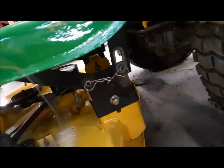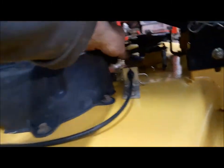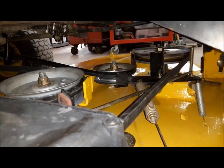Last thing we have to do is engage the PTO cable. First, this spring goes and engages the hole in the idler lever — I can feel it with my finger because I sure can't see it. Then we pull the cable back and put it through the bracket, and put our hair clip through it. Right now the belt is sloppy, but if I go up and engage the PTO it should pull this idler over and tighten up the belt. And yeah, perfect — it's pulled everything nice and tight.